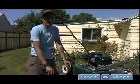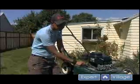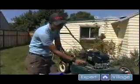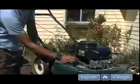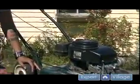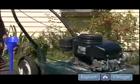First of all, locate your oil fill plug. On this unit, it's right here. So you want to loosen that up. Remove the plug. Set that aside. Grab your funnel and your oil.